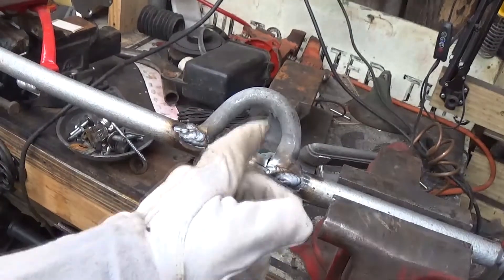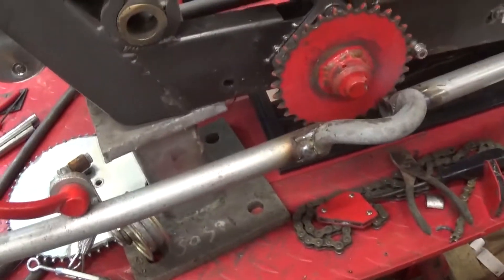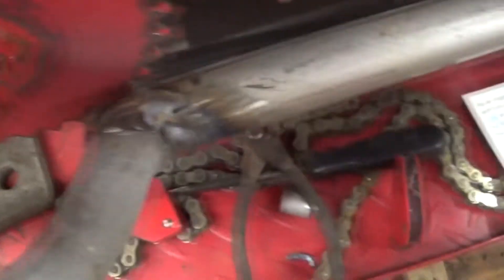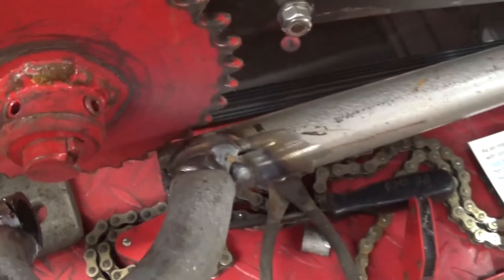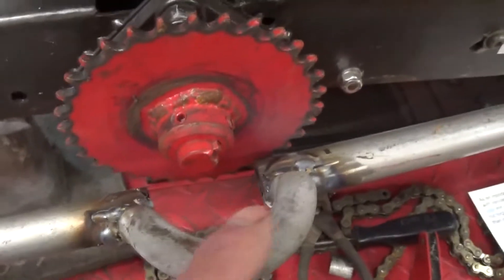It ain't pretty, but it's welded around the important sides. Now we're going to cut this out and then finish welding this to the pipe down in there. This is our test fit and it's good. It's still hot down in here, but you can see my mark. I'm going to taper this edge back towards the front to give my chain plenty of clearance. We don't have any problem anymore with interference with the hub, which was the main issue. I also had this spaced out down here and I'm pushing it back into where it was originally.